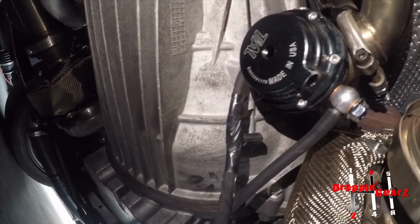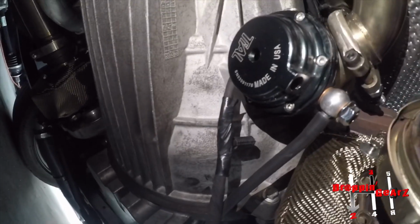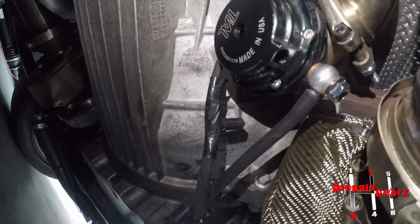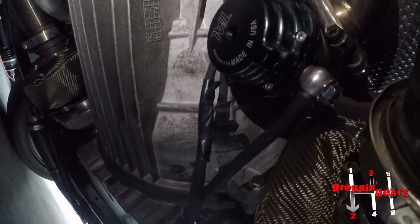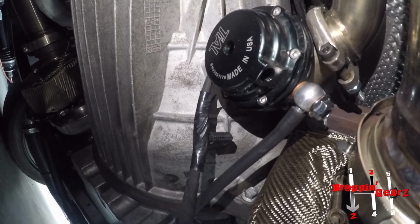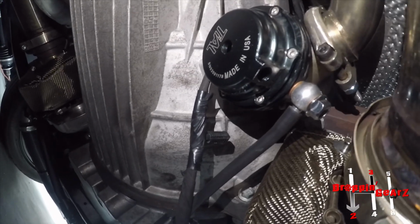And okay, so then we also got the wastegates. Those wastegates are not genuine wastegates. Those are basically eBay knockoffs. I looked at the serial number, and both of those wastegates, I had to take them apart, because they were both leaking horribly when I tested them, because I tested them before I even installed them on the car. And I wanted to make sure they work correctly, of course. So I took them apart. I smoothed out the shafts because I saw a couple of YouTube videos on how to make eBay wastegates better.